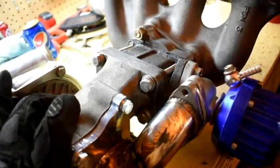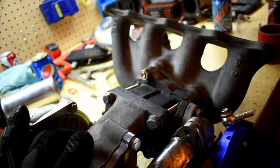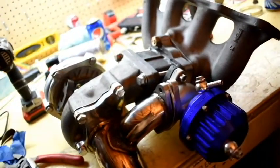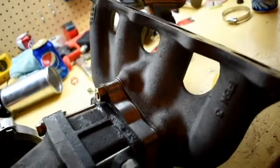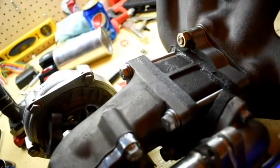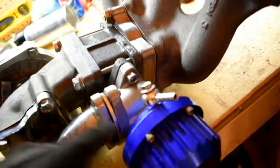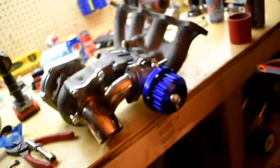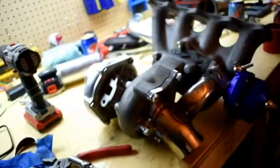So it's definitely a decent process getting the old manifold out and all these problem solvings, but just relaying to you guys. The main reason why is because since I got an Evo manifold, it usually has a built-in wastegate, or an internal wastegate, so I had to go with an external. So I got this adapter. That's what made it too long, so it sat too close to the transmission, and this would not even fit at all. So that's what we're doing now. So let's go ahead and I'm gonna remove those and then test fit this and see how it goes.